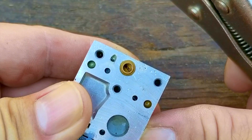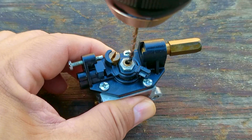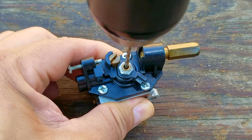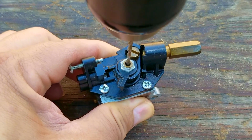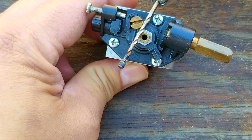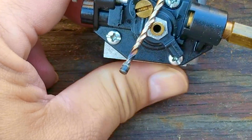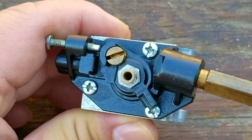Once it's out, you should be able to see a slotted brass screw under the cap. The H screw is hidden with another cap in the middle of a hole on top of the carb. For this one, I'll use the same drill bit and drill into it until it grabs the cap — do this at your own risk because you could easily damage your carb. The slot for the H screw is very hard to see on camera but it's about half an inch down in the hole. Once these are gone, I'll begin to reassemble the carb.